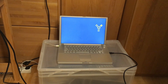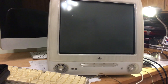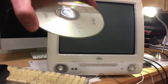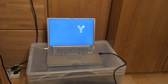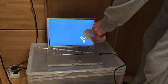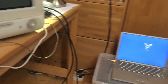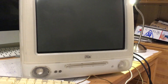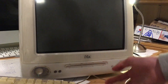Now we can use the optical drive with the G3 iMac. We've got macOS Jaguar here. Before you ask where the ISO is — go to winworldpc.com and download it there. Anyway, put the disc into your DVD machine and then boot the iMac. You can't just boot it normally — you need to tell it to read the CD, so you boot it and hold down the Alt/Option key.